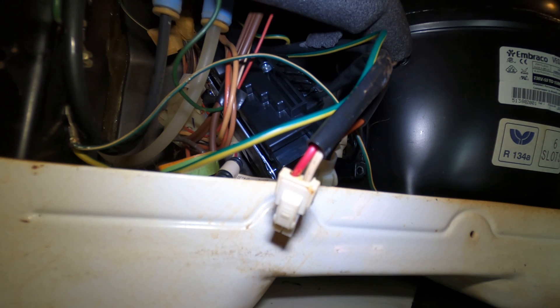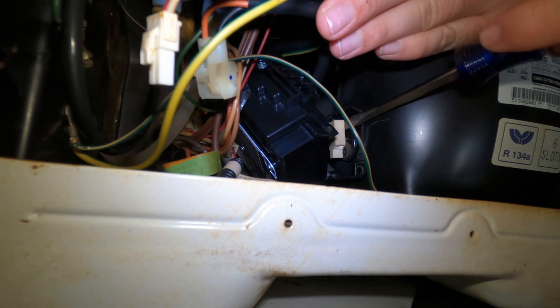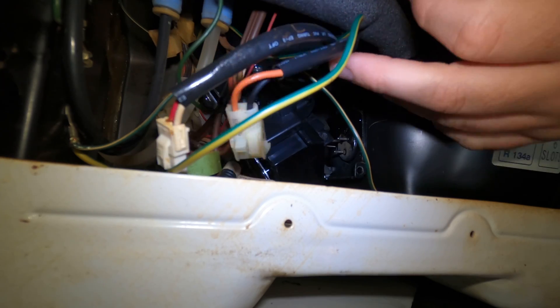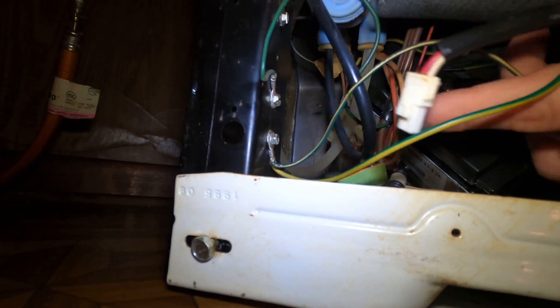You saw me take out that one Phillips head screw that holds the inverter in place — once you do that, the cover comes right off. Then you disconnect this connector. Once the connector is off, you do an ohm check. On these compressors with inverters, there are three pins. You go from pin one to two, two to three, and three to one — each pair should read around six ohms.